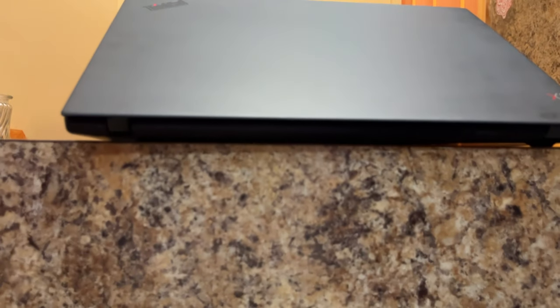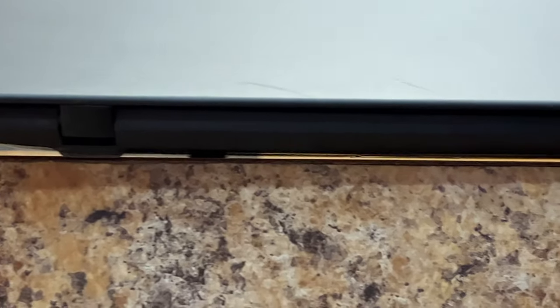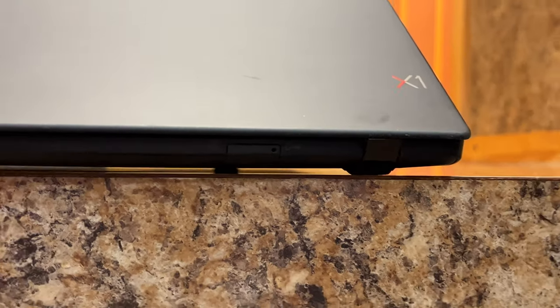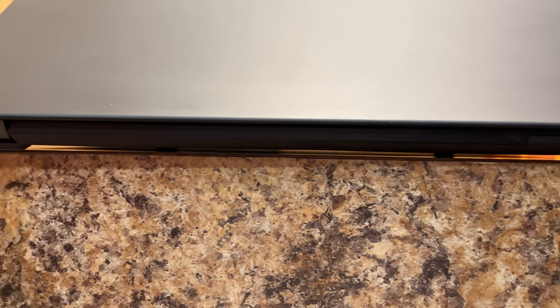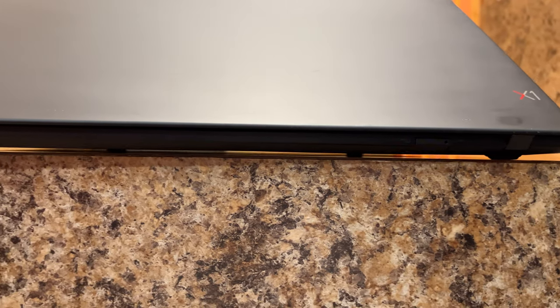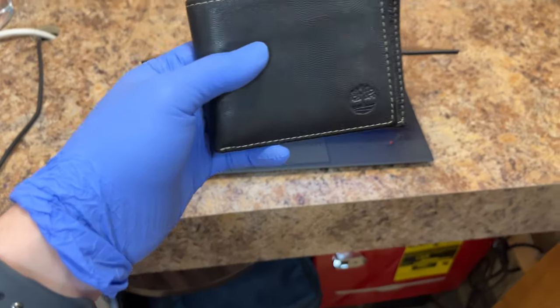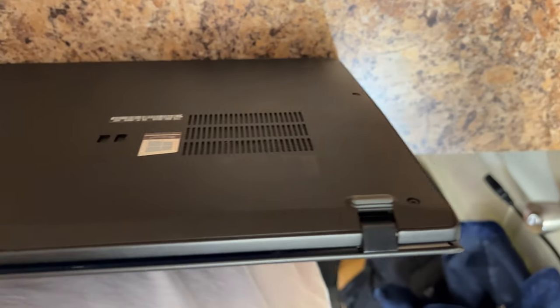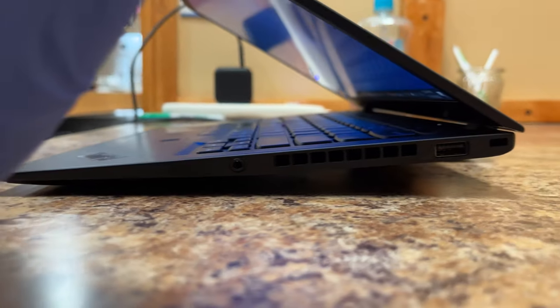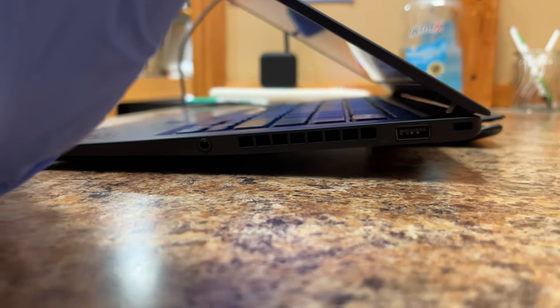I teleported to my other bench. Here's another tip I just wanted to show real quick. Do you see how little space there is for cool air to come in through the bottom of the laptop? What I usually do is put something underneath the laptop to make that space a little bit bigger, so there's just a little more room for cool air to come in before it hits the heatsink. I'll usually take my wallet, since it's usually empty and flat, and just put it right there. I don't want to cover the actual vent, so I'm going to place it right in the middle.